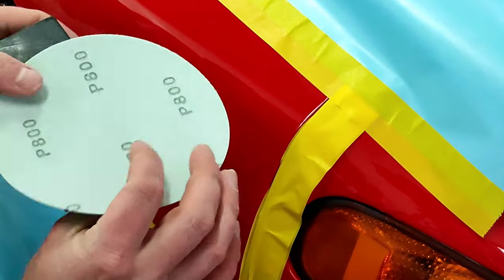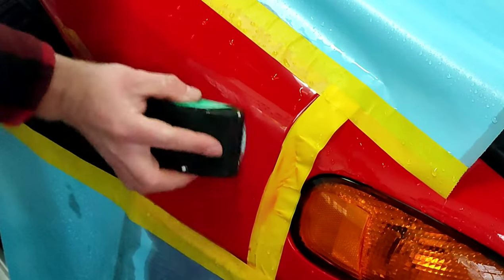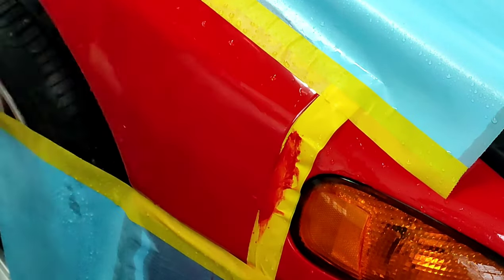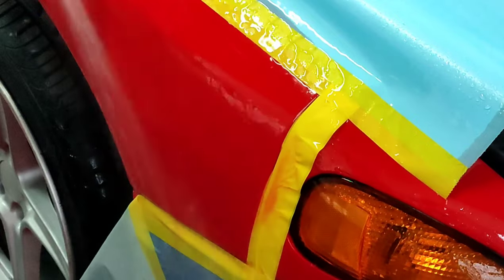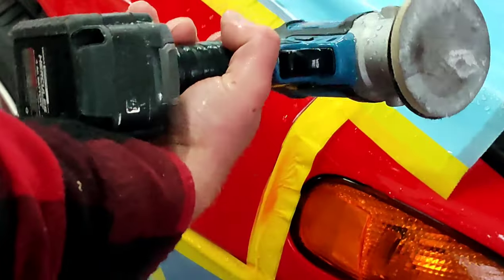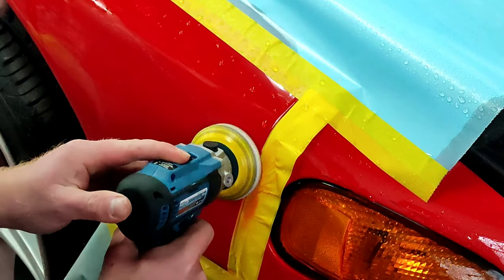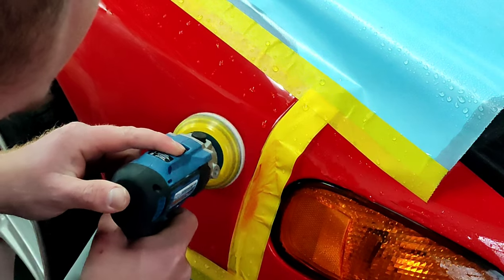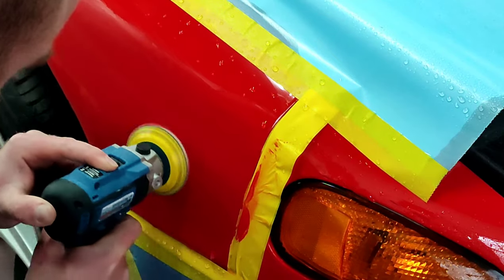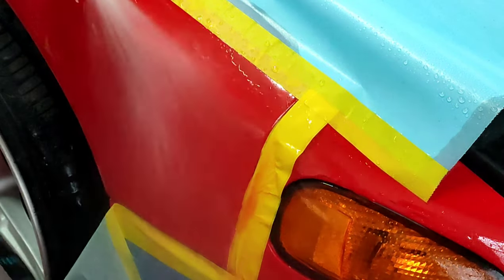Runs that are this thick and chunky, I like to start with 800 grit, 1,000 grit — grits like that. Go ahead and knock it down flat fast; this will make the job go by a lot quicker. Then give it a thorough wash, make sure all your sanding grit is off. You don't want to go from 1,000 to 2,000 and still have 1,000 grit left. This is 2,000 grit on a machine — it's like a sponge pad, so it's going to knock out those 1,000 grit scratches really fast.